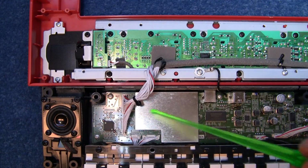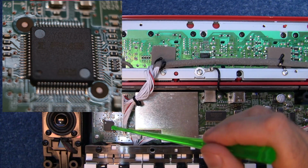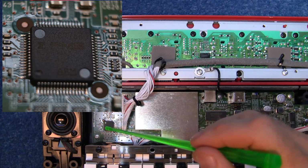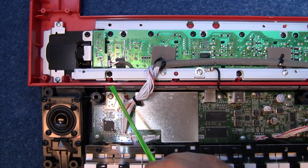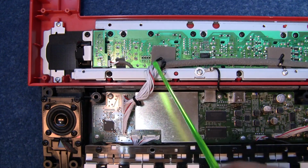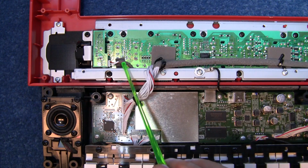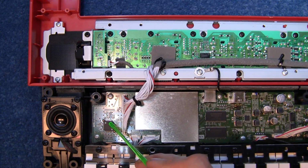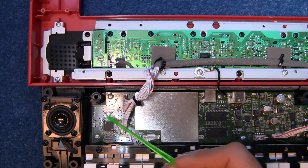Now the first thing on the circuit board I see from left to right is the ARM Fm3 chip. This is likely a 32-bit general purpose MCU, and these are based on the ARM Cortex M3 CPUs. Now this, judging by where it is, I mean, it's connected to the board along the top that's got all the controls and sliders and everything on it.